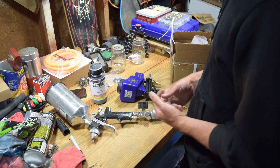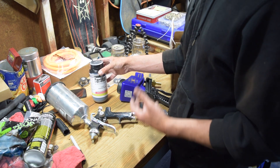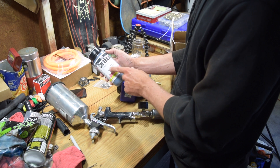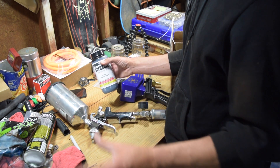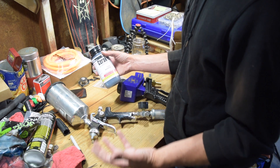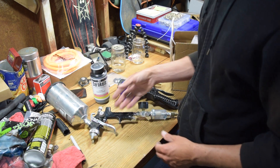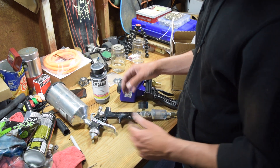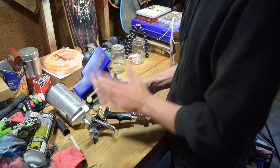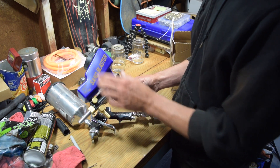What we're going to be doing is essentially taking a lot of the parts I've been mocking up in my engine bay, cleaning them off, degreasing, and prepping for Cerakote — specifically the C-Series, which is air dry, so you don't need a kiln or oven. It air dries over five days. You apply it just like paint using a paint gun — I've got a cheap Ingersoll Rand with a 1.2 or 1.0 tip.